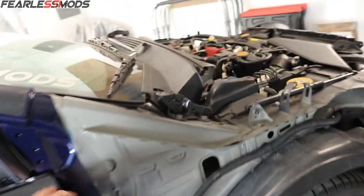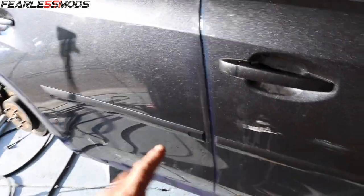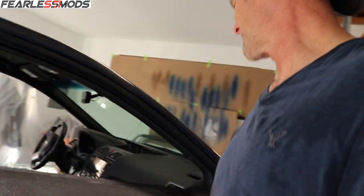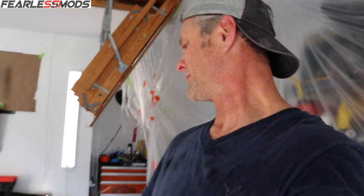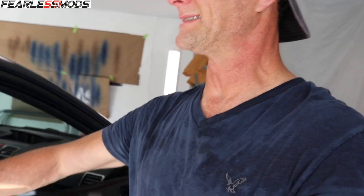The doors are hung. I'm going to have to do a little bit of final adjustment later on. The back one looks really nice — it's got a good gap. Through the center doesn't look too bad and we'll see how the front is once I put the fender on. This rear striker plate is raising the door just slightly when I shut it, so I believe that's going to require just a little bit of a two-person job to get the rear end of the door lifted up while working on these hinges. It's hard to do with one person and a jack, so probably a little two-person adjustment later, but this is good enough to get it finished off, taped up, and sanded.